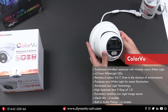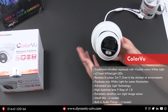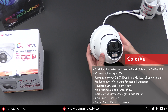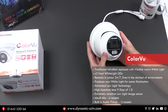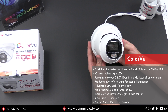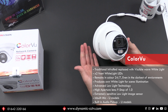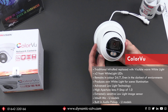The ColorView IPC also has very advanced low light technology. It's got a very high aperture lens with an f-stop of 1.0 and an extremely low light sensitive image sensor. The aperture of the lens is a massive factor when it comes to how much light hits the image sensor. As we all know, the image is dependent on light - the pixels on the image sensor are dependent on light to produce the image, so the amount of light that passes through the lens is a massive factor.